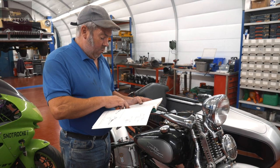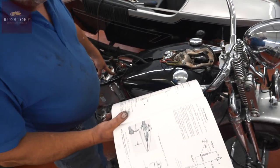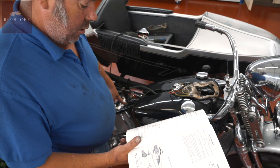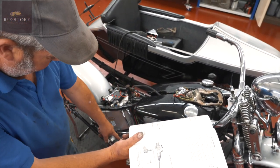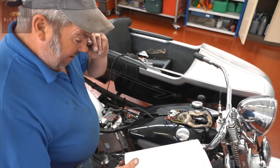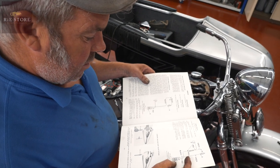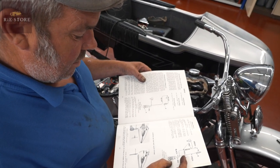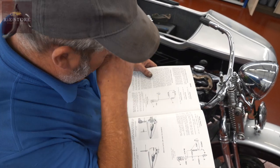So we've got to pick another wire up off the brake light switch to feed your side lamps and your normal running lamp on the sidecar wheel. And you pick another wire up from your brake light switch to go all the way back over to the brake light on the back there. They've got a joined up one on that. That's a later 47, so we'll go with that one, it's easier. Okay.